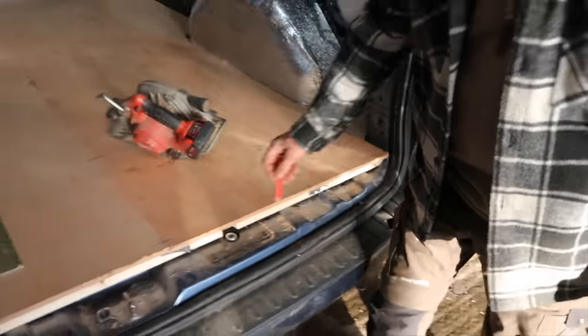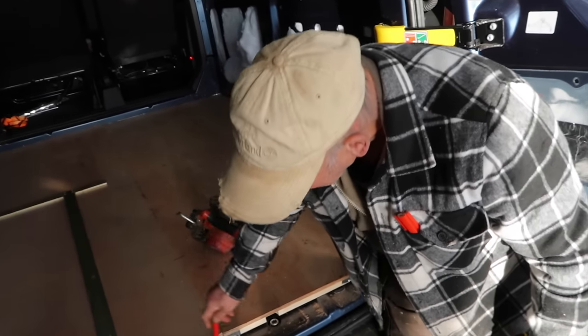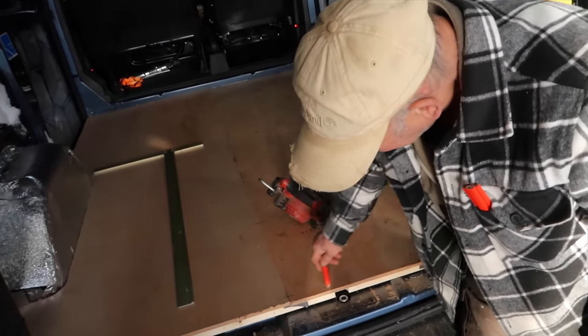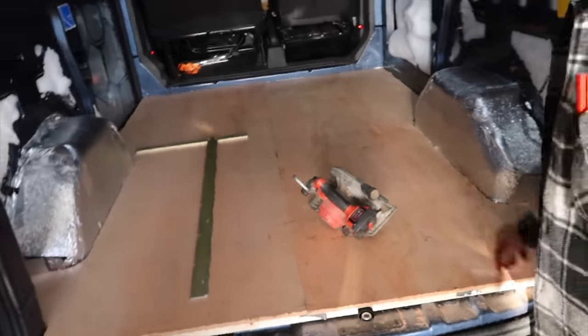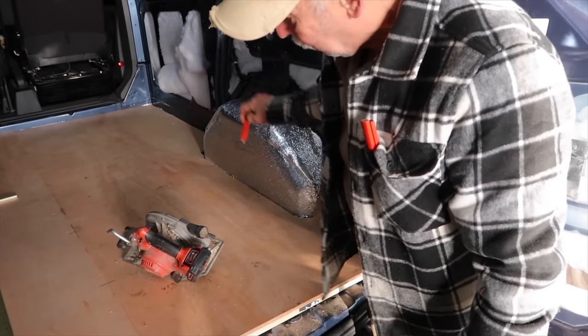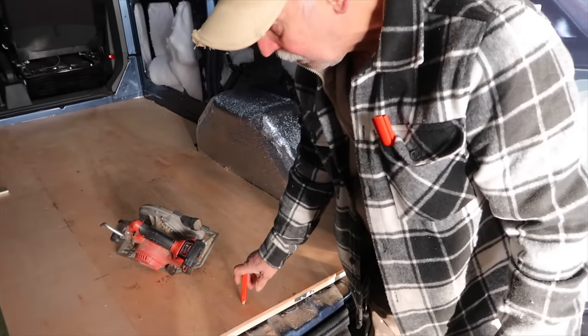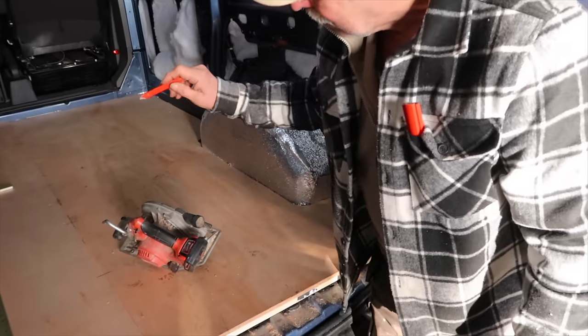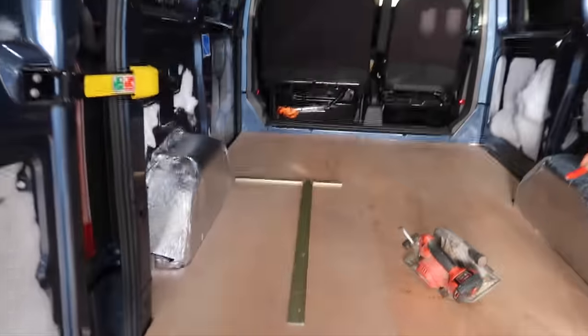What we're doing at the moment, we're trimming the panels off so we get a nice flush finish with the batten underneath. So when we finish it off with a piece of oak, we've got a nice finish. Right, nice. And then we're going to mark. We've marked all the battens there, so then we'll strike a line across them all, pre-drill it, so we'll get a nice finish with the screws into the plywood, countersink them, and then it won't show through the line off. Perfect. And then these are going nowhere.